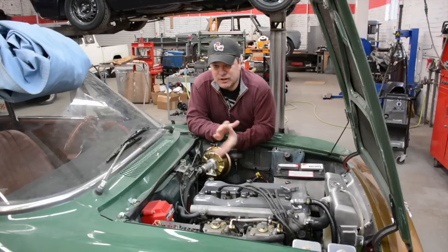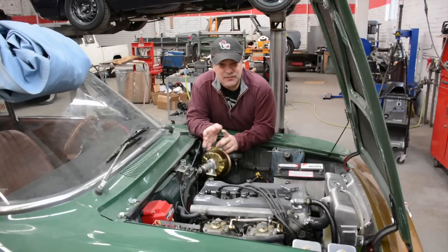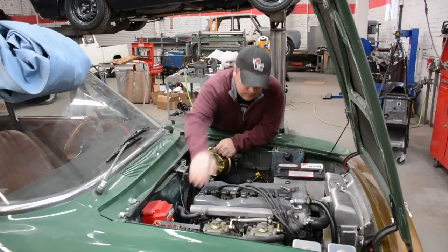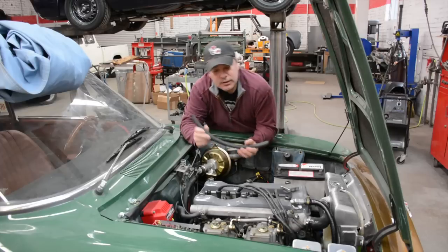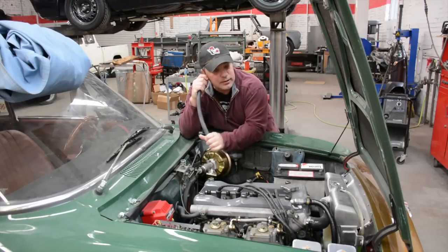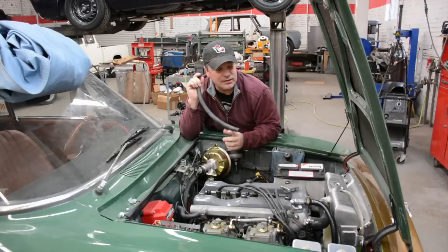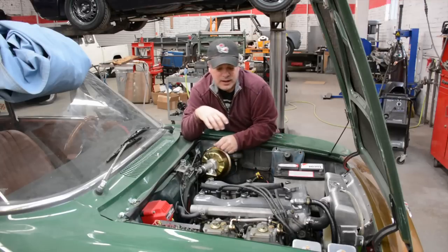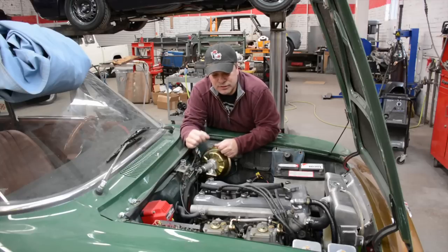The person who develops all our top-end work on our 155, 75, and performance motors was here with a guest a couple weeks ago, and he came up with a very clever idea of how to source where the sound was coming from. What he did, took a hose, and like a doctor uses a stethoscope, he placed it in key locations around the intake to solve where the squeaking sound was coming from. And he concluded that it was coming off of the number 3 intake port somewhere.